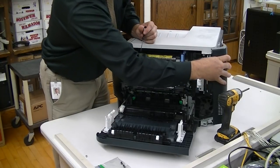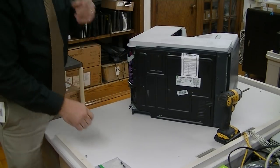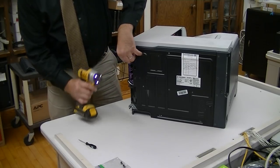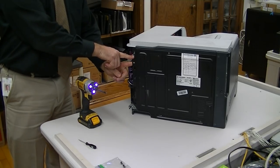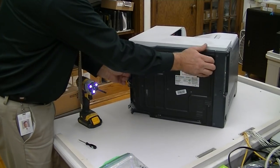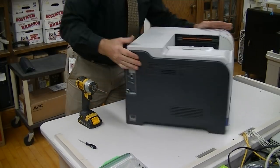Just like that. It goes back in reverse order. I didn't take out any toner cartridges and I didn't take out the fuser or the internal transfer module. There's one screw here that holds it from the other side, and that's an internal silver screw. Then this will slide down. Once I take that corner off, I've got to take that corner off first.